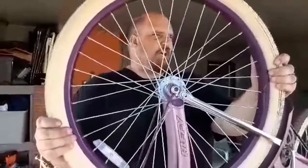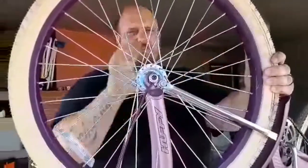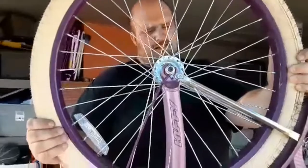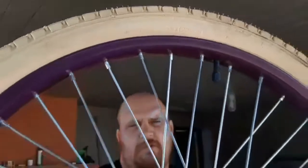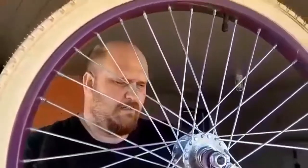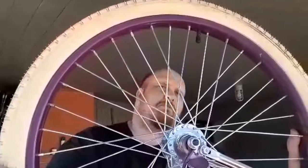We're going to find that white whale. Back tire seems to be inflated pretty well on my wife's bike. This one, though, for some reason, whoever put this together doesn't exactly have the stem in correctly. I'm going to try to see if I can pull that out. It's got a little bit of air in it, but I'm guessing it's probably around 10 PSI — it needs to be at 40. If you're wondering where I got my PSI range, inside of each bike tire it actually tells you what you should inflate it to. This one does say 40, and that's kind of what I'm going for.